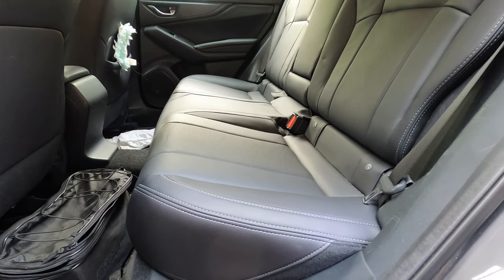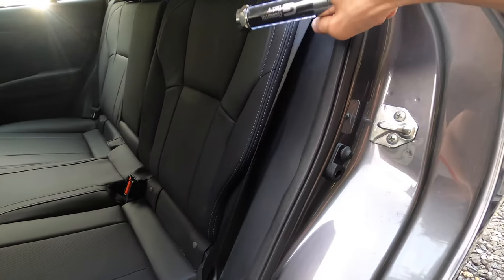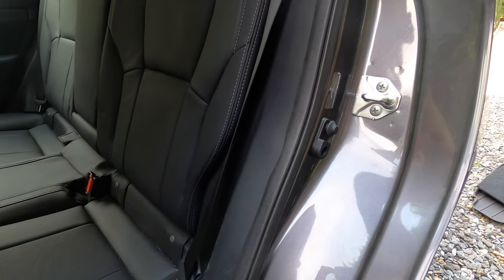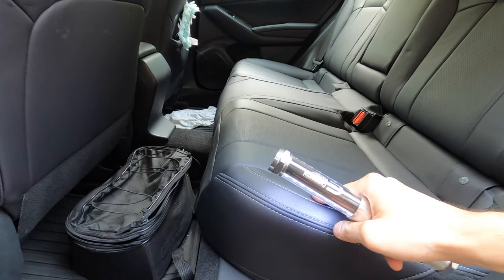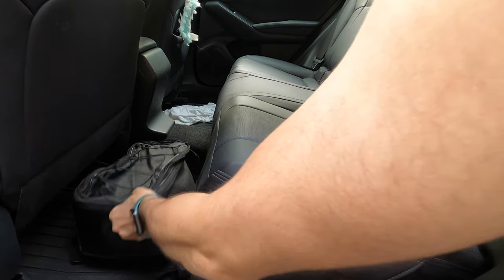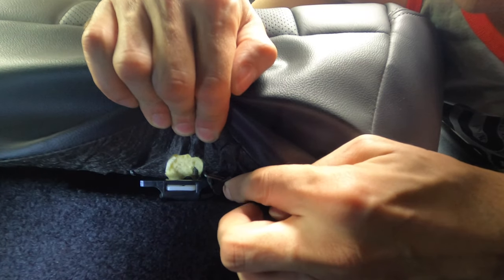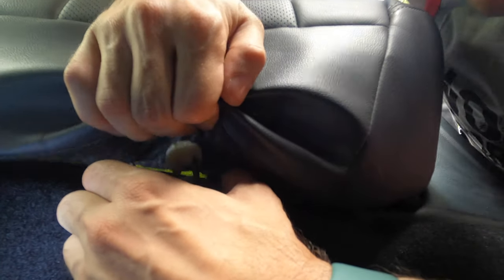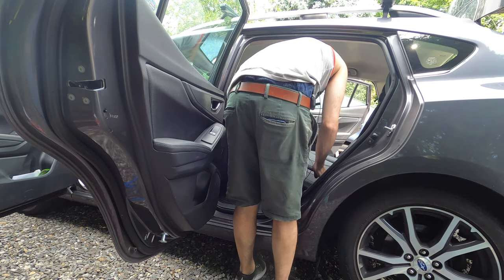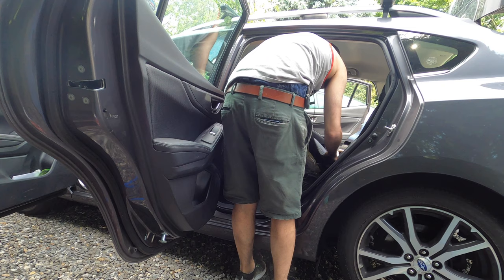In order to make it as easy as possible to remove the rear side panel, I suggest removing the back seat. It comes off very easily by releasing two clips on each side and will make your life so much easier. You can see there's a little black clip — all you do is pull that forward and just pull the seat and it comes right up. Do that on both sides. With both clips out, all you do now is just take the seat right out.